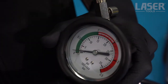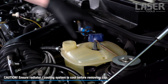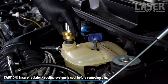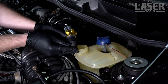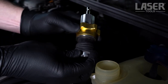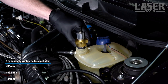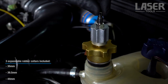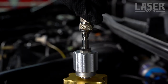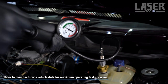Now let's see the tester in action. Remove the cap and fit the tester into the filler neck. This filler neck is quite wide, so we fit one of the three expandable rubber collars to take up the slack. Adjust the tester to get a tight snug fit, then fit the pump to the tester and apply pressure. Pump until pressure is approximately 10 to 15 psi — that's all that's needed.